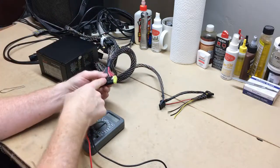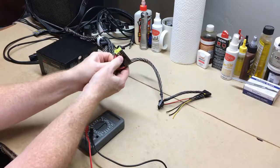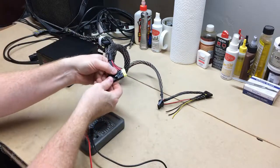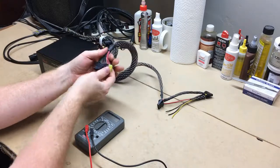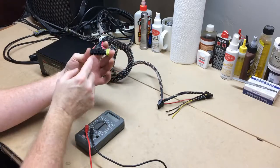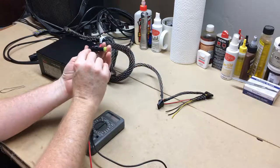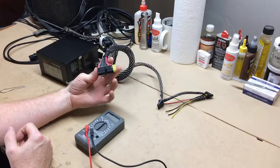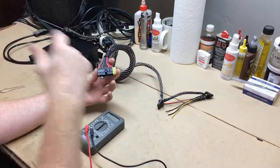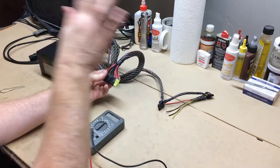There's a power-on jumper in this connector that gets wired to the motherboard, which goes back to the power switch on the computer. All that power switch does is the same thing we're going to do on this connector. You just need to jumper the power-on pin to a ground wire in the power supply. On a 24-pin power supply there are typically seven or eight different ground wires — any of them will work. I've taken a big paper clip and I'm going to use it as a jumper. The paper clip slides into the connector and stays fairly snug.